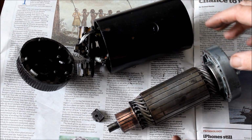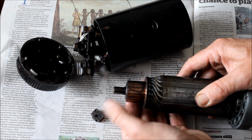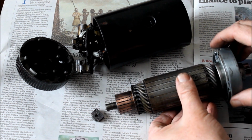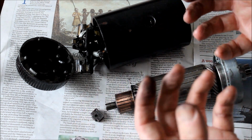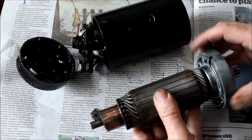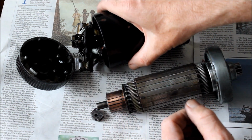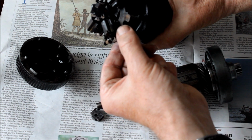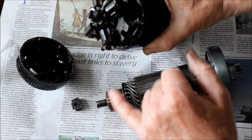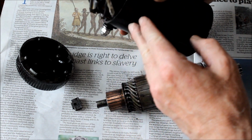And so I've just taken apart the starter, as you can see, and first of all it looks very dirty. I mean, these should not be oily and wet like that. They should be clean and dry. Next thing I noticed was, as I took it apart, you had that electrical burnt smell, which isn't ideal. The other thing I noticed was the bearing on here looks fine, and as I'm taking it apart I noticed this top plate here with the bushes, the spring bushes that are pushed against this armature here, is very grotty. They're very dirty and pretty tired looking.